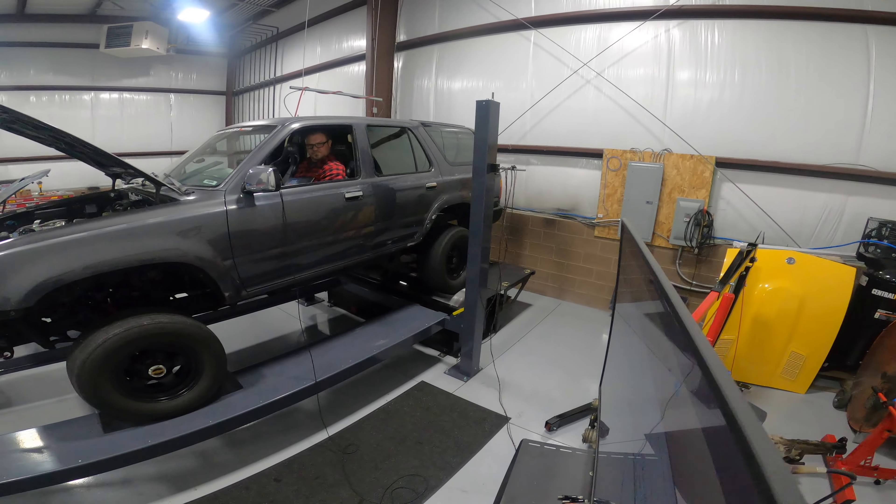This was on the gate at 467, and then this was at 38 psi. Smoothed the fuel out a lot — it was real fat up top. Smoothed the fuel out, gave it a little bit of timing, and then it really woke up with the boost. That turbo is really efficient — the horsepower line goes all the way up until the engine is actually past its efficiency, so plenty of turbo. For our knowledge, this is the fastest 4Runner in the world — if anybody knows any different, drop a link in the comments. Appreciate you guys checking out the channel, go ahead and subscribe so you don't miss out on any content like this. Hit the like button, drop me a comment, let me know what you guys think. It's a pretty wicked machine. Unfortunately all the track days are canceled this year because of COVID, but we will be getting this thing out next year — just keep leaning on it, give it some more boost, keep sending it.